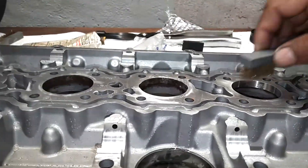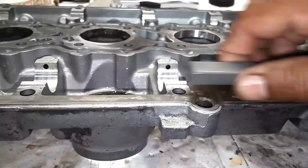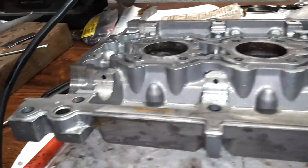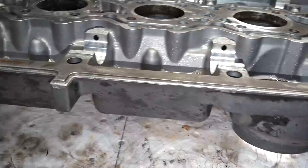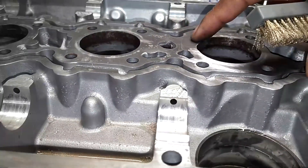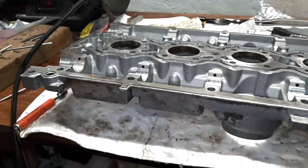The best way is a brass brush — it's usually softer than the aluminum. You just brush it until you get all the anaerobic sealant off. You can't always see or feel it, but you've got to get as much off as you can. Right there there's a coating of it. Wet your brush and brush it on there, or rake a razor across it. Be careful with the razor — you don't want any gouges, you don't want to cut into it. But get all that dry anaerobic sealant off of there.